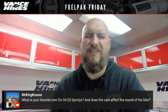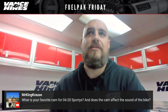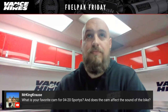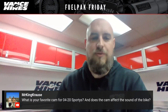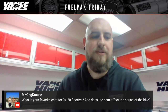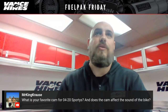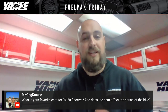Feuling makes a nice one. I want to say the 505. S&S has a couple good options. I've always liked the Andrews grinds. I had a set of Andrews N6s in my old 03 Buell-powered Sportster, and that thing was really, really awesome. But the N4s are a better bolt-in option for most people. Lower end torque, not as much top end. You don't have to have quite the head work that is needed to support something like an Andrews N6. So I think it depends on the application, but for the most part, if you're just talking about a stock Sportster, for me, it's Andrews N4.